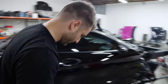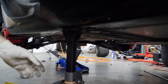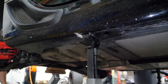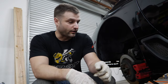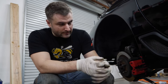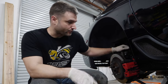Before we move forward, we're just going to check these jack points, make sure they didn't rock. It did rock — that's even further back than it's supposed to be. It slipped. It was directly on the point where you put the jack; now it's on the body because it must've rocked. This is why you check. I'm going to pick up the rear further and slide this back into the correct spot, because all we need is the whole Corvette falling off the jack stands. All jokes aside — which is why I didn't go under the car — I did have an older friend of mine actually die. He wasn't using jack stands. Even with these jack stands you've got to watch out. I do know of one person who passed away with just a jack, and even with jack stands you still gotta be careful.